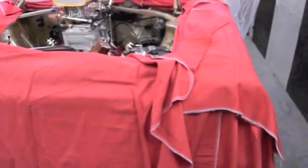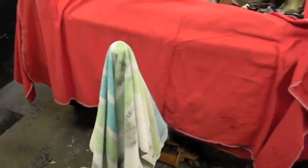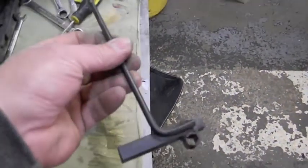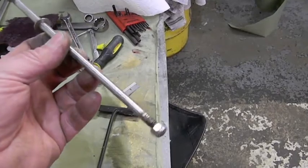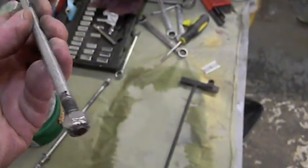This car came with a factory hold-down, which is very, very rare on an AMC that they survive — because they run so close to the post that they corroded away. It was absolutely mint sitting in the back, so I cleaned that one up and put it on the '68. And I made this one, which as you can see is just two pieces of angle iron — I bent up some rod, welded some tube on, double locking nut, threaded rod. We're going to sand these all down and clear them; it's regular steel. The bracket sits right across — it's a through-bolt of 3/8 rod — and the battery stays there. They come nowhere near the posts.